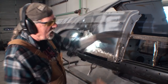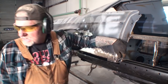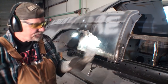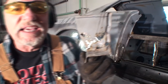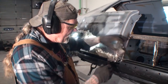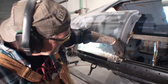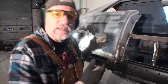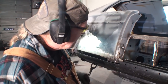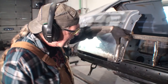But as we're looking in that area, this piece right here was rotted — and when I say rotted out, here it is right here. So this is the piece that literally came out of here, and you can see that we kept some of the old rocker panel and we were going to butt weld that up. It would have looked really nice and everything would have been handy, but what has happened is that we can't use this anymore because it's rotted. You can see it right there — rotted piece.